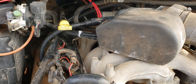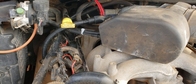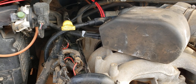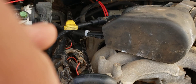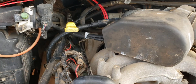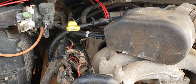That ought to work a lot better. I don't know if that'll fix my problem — if it's still hesitating and not running right, then it's probably something else, maybe the fuel filter needs to be changed. But I know for a fact that PCV line and that stupid elbow weren't like they should be. This should let it breathe a lot easier. Because if that line's disconnected and that valve's not working, your truck's going to be pretty gutless — or it won't run at all. If you pull that line off while the engine's running, it'll just die. It doesn't really like to not have that connected, so that's pretty important.